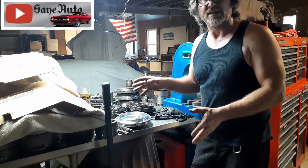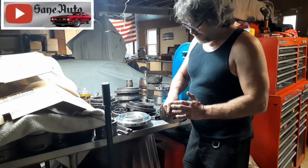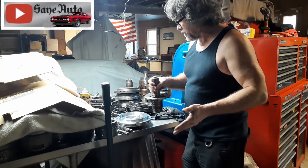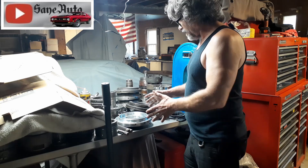That ring broke right there and doesn't want to spin, but these others turn fine — this one's pinched where it's damaged. So many different ways these stators can be bad and you need to look out for that. They also have a bushing here in the front; the bushings can be replaced, but these other things I've been showing you on the stators — you can't fix that, you just have to change the stator.